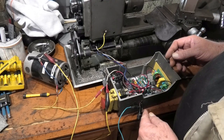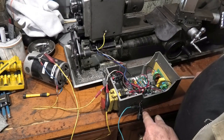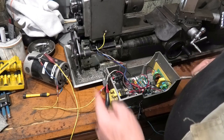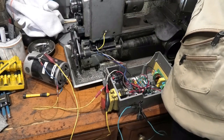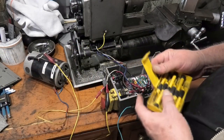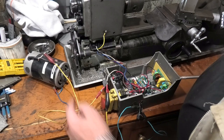I got my multimeter out and put it on the output wires to the motor — no power. Found a fuse on the side here. I haven't got a replacement fuse yet, so I put a jumper cable in and it now works. So I've got a spare motor — just got to fix the cable up on it. I know it's not just the fuse though, because there were sparks and smoke coming from the back. So it's got to be the motor, but at least I've got a spare.